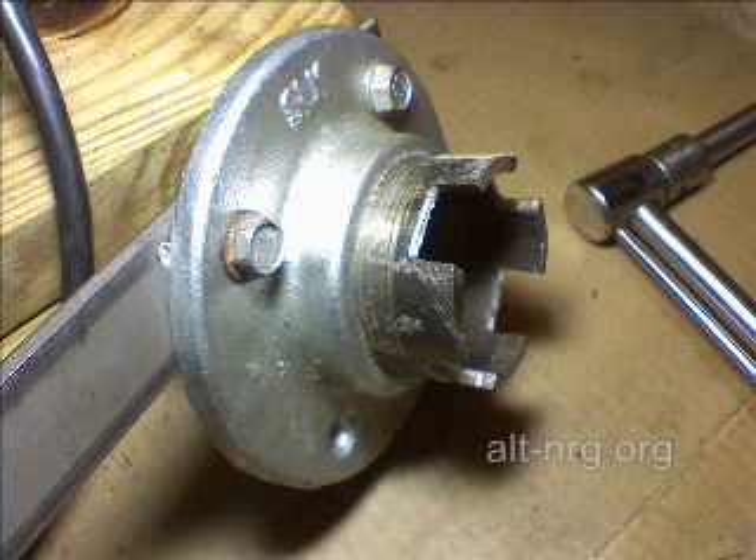This is simply a piece of two-inch inside-diameter black threaded pipe fitted into a galvanized two-inch floor flange, bolted to a one-and-one-quarter inch by one-eighth inch thick by approximately three-foot-long bar of steel. The components you see in this frame cost me a total of $22 at Home Depot.